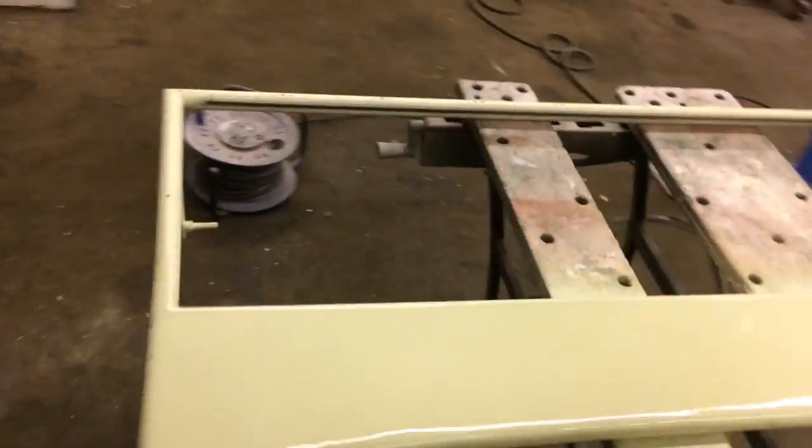Anyway, so once it's all like that, and this dries off, this is what I just sprayed on, you flatten it off with sandpaper. Basically, you start with 120 before, and then you start coming up: 240, 320, 400, 600, 800. The larger the number, the smaller the grain. And the last one you do is this, which is like a kitchen scrub, which is very thin. That's called Scotch-Brite. And you do that, it's really smooth, and then it's ready to be painted